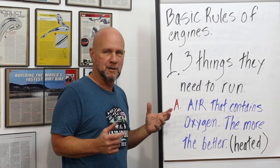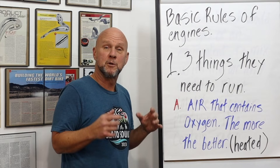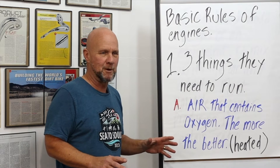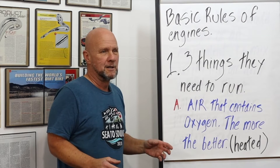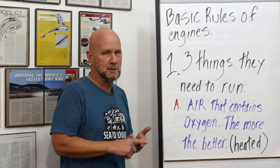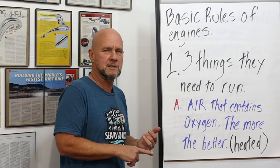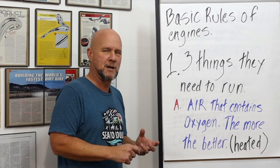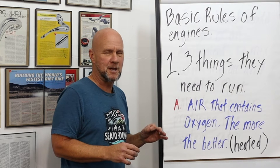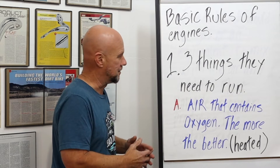When I was a kid, I bought a Honda Z50. I was 10 years old — a 1968 Honda Z50. You put a new spark plug in it, you kick it over once, it would start. You kick it over again, it wouldn't start. It took me a year to figure that out. It was me on my own with the service manual. I didn't have help from anybody. My dad didn't want to help because I don't think he wanted me to get it going to ride it. It was the wrong heat range spark plug. It needed a six. I kept putting a seven in it because I would take the one out of the bike, take it to the shop, and they would give me that same seven. It would start the first time when it was dry. It wouldn't start the second time because it was wet. Simple. But if I knew some of this stuff, I probably would have fixed it sooner.